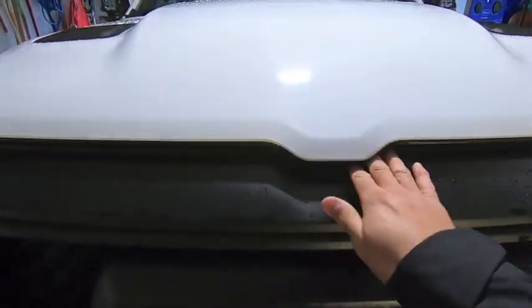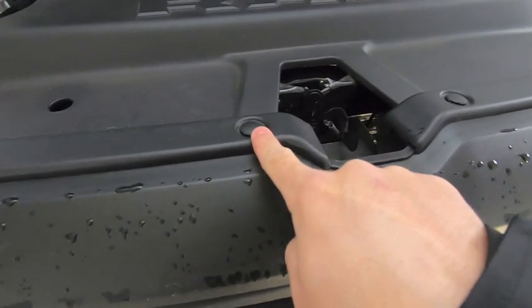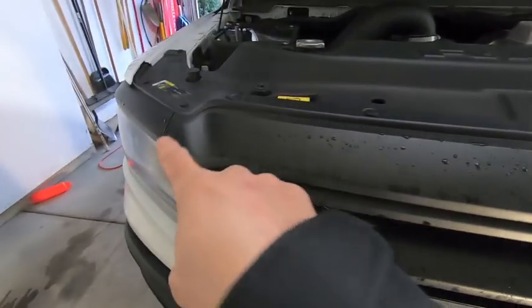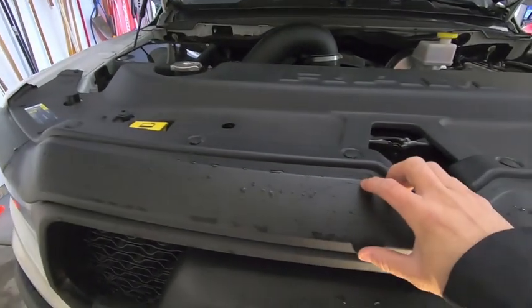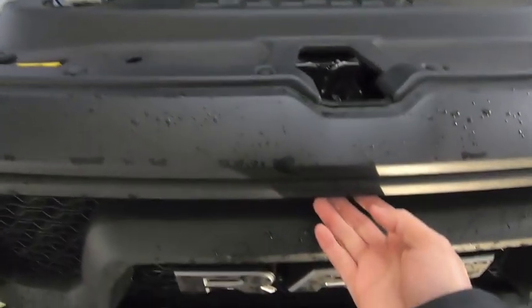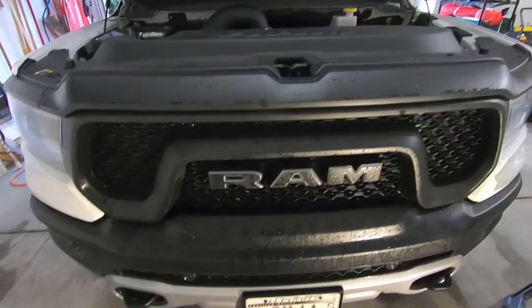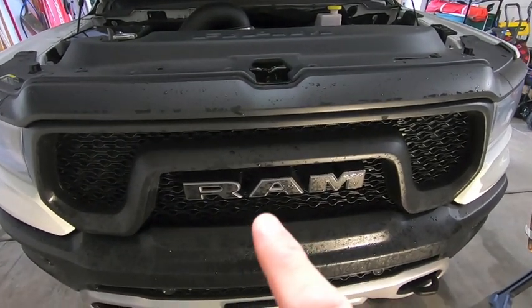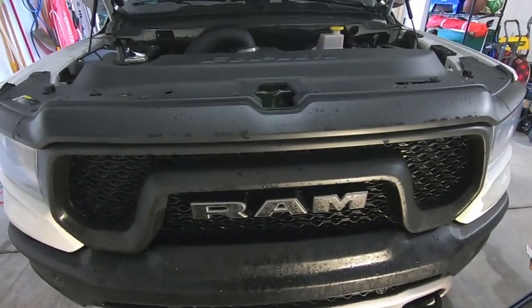I dropped a poll on Instagram asking whether to go with three lights or four lights, and by unanimous decision the four-light setup won. I'm glad about that because I like the way four lights work with this grill — they look really good. Three lights work well with some other grills, but the four lights somewhat offset are going to look great. To get started, the first thing we're going to do is remove the shroud — just take your trim tool and pry up these clips and pop them out. The second thing is remove this plastic trim, which has a bunch of 10mm bolts across the top plus some push pins. Then we'll slowly pry out the grill just enough to get access behind it.